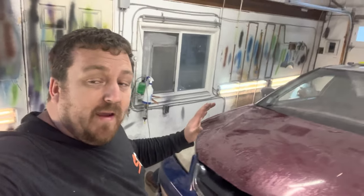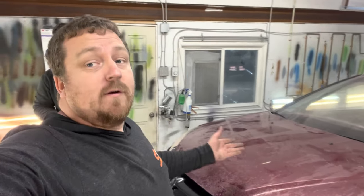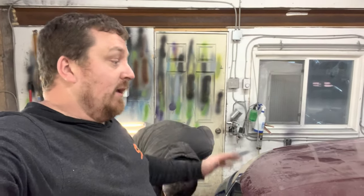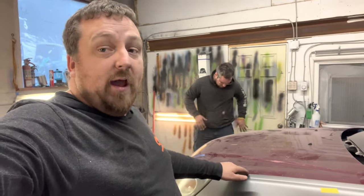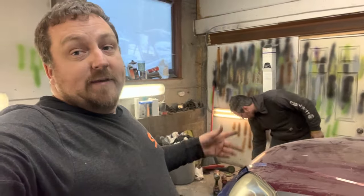I'm going to leave the video with that — there's a lot in this video and a lot of issues to address, mostly from doing version two before version one is done, which is the EL front end. Technically the EP3 rad would have worked for the civic bumper but it doesn't work here where it's lowered. We also have to fit the headlights a little better — just a couple more grinds — and then mount the front part of the fender where the hole doesn't line up. I'll show you the workaround for that. If you're new to the channel, subscribe and turn on post notifications.